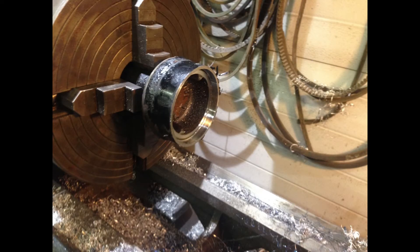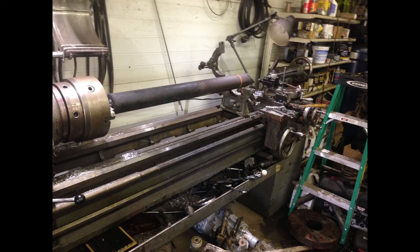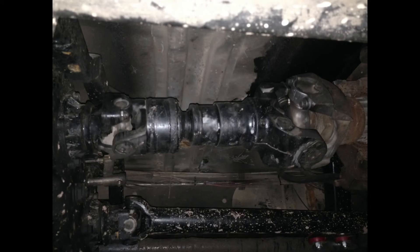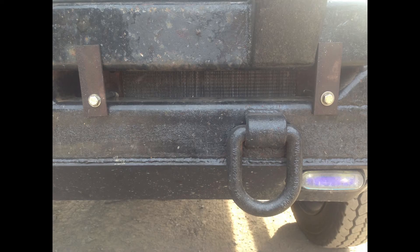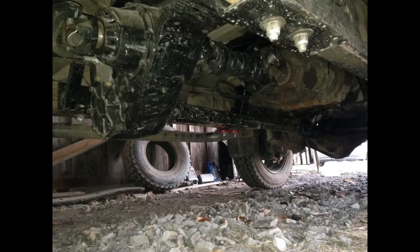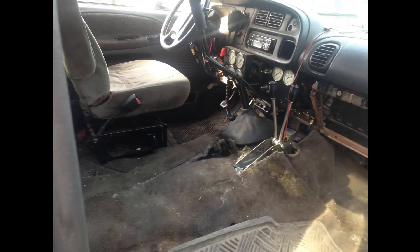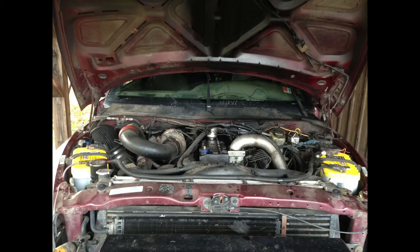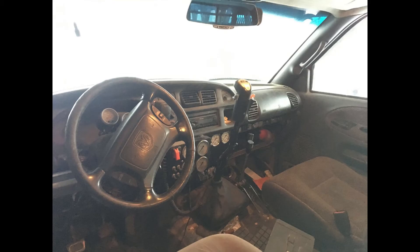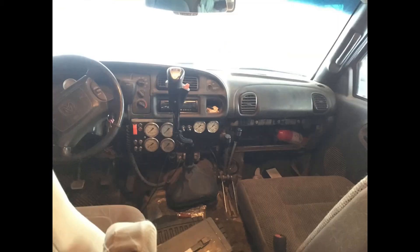Building the driveshafts — when I bought the transmission I asked for the driveshaft that was in it as well, so I just took that whole driveshaft, shortened it down, and adapted it to the transfer case. This thing lasted — I ran it for several years before I finally sold it. There's the oil cooler, and I had zero problems with the transmission; it just ran great. The only thing that ever happened was one point an elbow wore through and was leaking some air, and I had to replace that. I wasn't using this truck for chauffeuring people around, so it's a little rough and dirty, but it got the job done. I put an air ride seat out of that same tractor trailer in it while I was at it. It was a heck of a truck — there's nothing like drifting a 10-speed around some country roads.